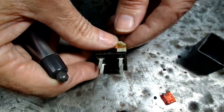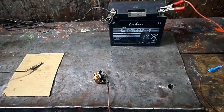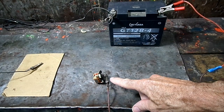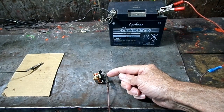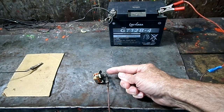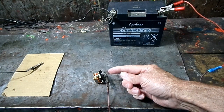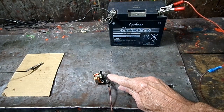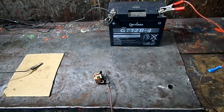We're going to add some power to this and see what happens. Here's how we're going to operate our relay: we have the positive wire from the battery coming down to number 30 and number 85 pin, energizing both those. Right here we have a small light wound around our output pin 87 and our 86, which is the ground, because we need ground and voltage to make the light work. Then once we take the ground wire and touch 86 to simulate the computer signal, the relay should energize and our light should light.